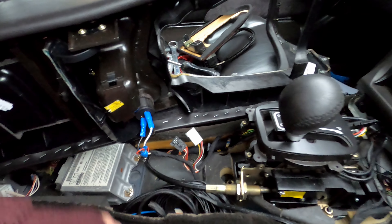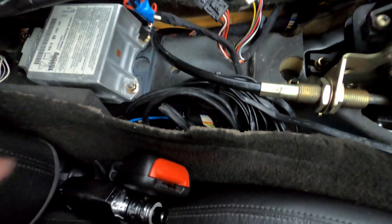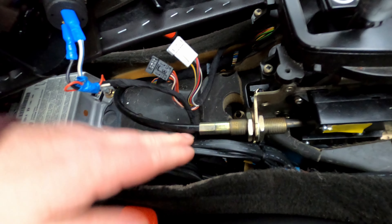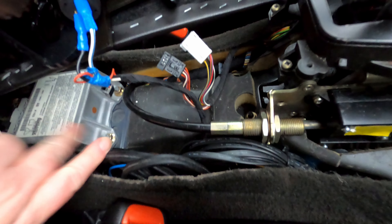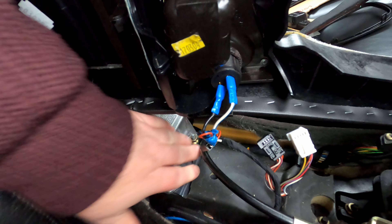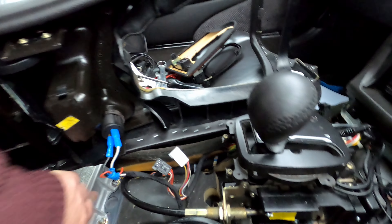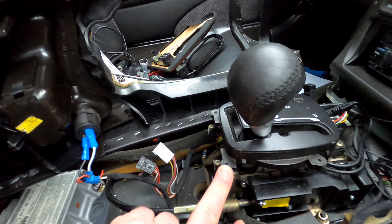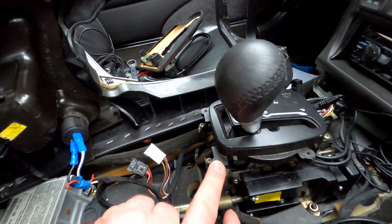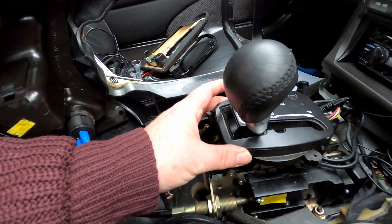As you can see, all the wiring just here is for the subwoofer. I'm going to try and just move that aside slightly and put it all back in place, because it was fouling on just here — which is the underside of the ashtray — as it was sitting around about in this position. Hopefully that will rectify that issue. I've also taken these two brackets off here — it's just two screws on each side — and hopefully when I fit it back in that will resolve the issue I had with the surrounding.